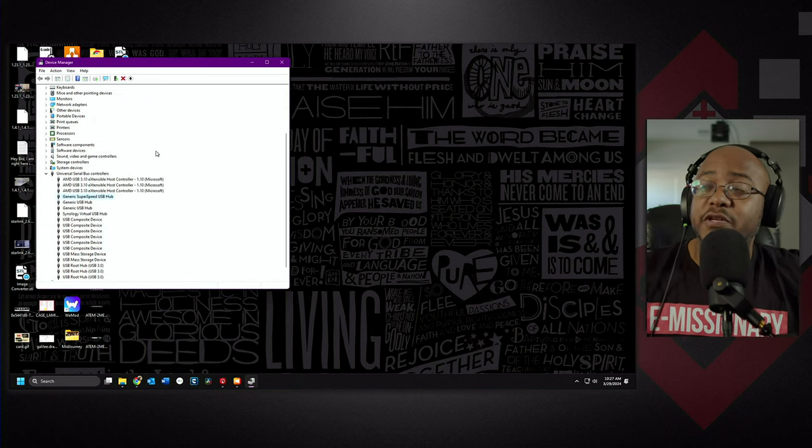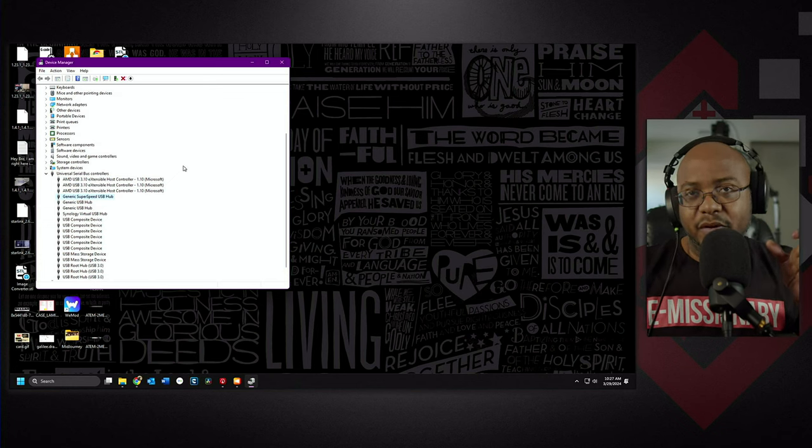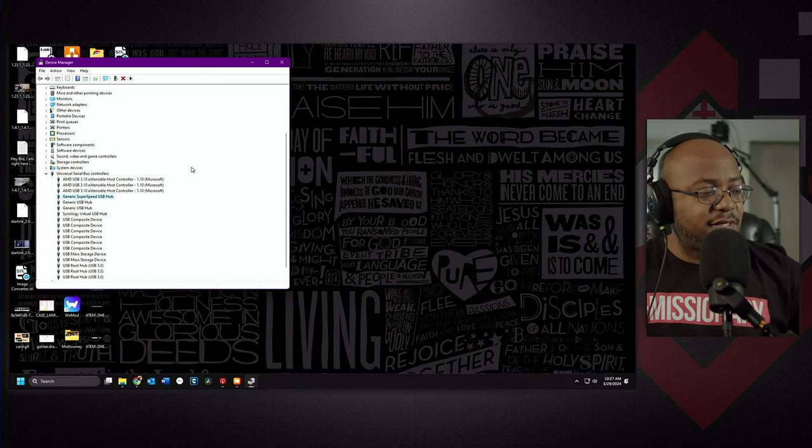That's the first thing I would check, because if you're seeing everything from your video switcher but you're not seeing it in OBS, that means either that's happened and it's gone to sleep, or the other question I would ask: does it stay permanently connected, or are you disconnecting the USB and plugging it back in? Because if you connect your video switcher to a different USB connection from week to week, it shows up like it's a different switcher. You always have to keep it in the exact same jack. Mine, I never unplug, but those are the first two things I would say check out.